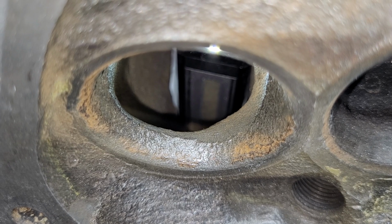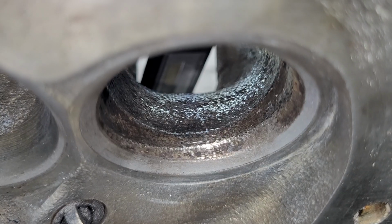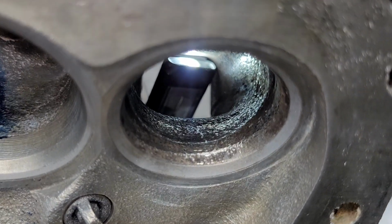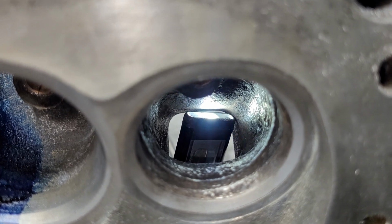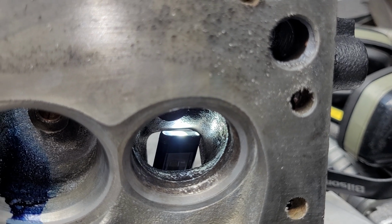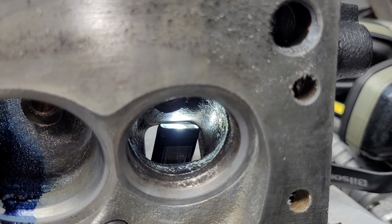Okay, the LA short side radius on the exhaust. Ugh. We know it's a problem. Take a look at how much different the Magnum is. It's an absolute thing of beauty compared to the stock LA. Okay, it's curved the right way. It's got a decent shape. It's way smaller. Wait a minute, Charlie, smaller isn't good. Yeah, well, actually on an exhaust, it is good. Remember, this head's only designed to go, what, 4,500 RPM? And you'll see when we get to the flow curves, the way it's designed, I bet works really well in a stocker. I think I've only been in maybe one or two of these Magnum headed 360s. Lots of grunt for a 360 cube motor. Lots of grunt.